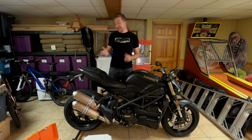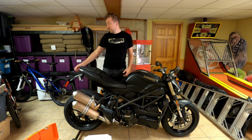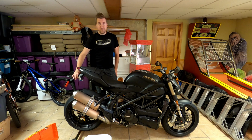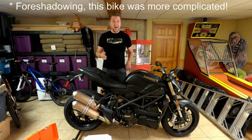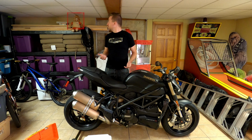The next thing is, if there are any sharp edges on your license plate, they have you go through and make sure that the license plate is either removed or that you put tape around it. I'm actually going to remove the whole assembly, including the blinkers. It's only 4 screws that hold the whole thing on, unplug it, and then it should be fine. So the next thing that they check...